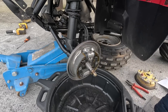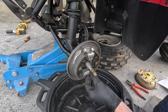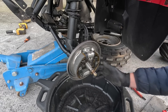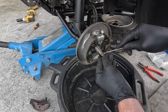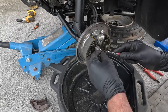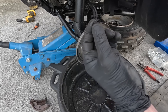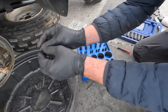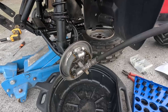That's the set of brake shoes on now. You can adjust them afterwards when the hub is on through a little hole. That's your brake pads on. But this little O-ring is completely gone here - it doesn't do a whole pile but it's completely shot, so we'll put a new one on there. There it is - you know me and my grease. Just a small wee bit will help that hub to go on.